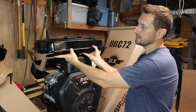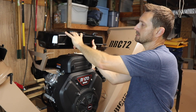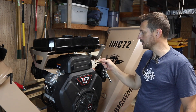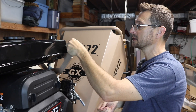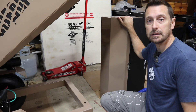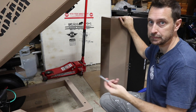The gas tank is going to mount here on the top. You don't want to tighten the brackets on the side all the way first because you need to get the tank in the proper position. Once the tank's on there you can tighten the sides. Then you will use this small piece of fuel line right here to connect the fuel filter to the shutoff valve. It's 8 AM and it's already 93 degrees outside, and in this barn it's even hotter. The last piece to put on is the chainsaw slash storage box — it just goes on the back of the frame with these four long bolts, pretty easy.